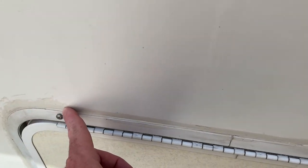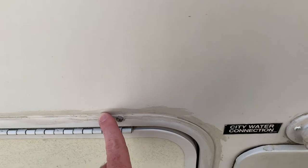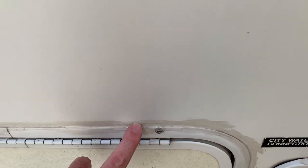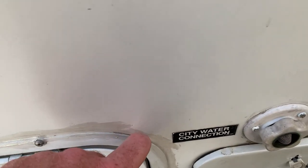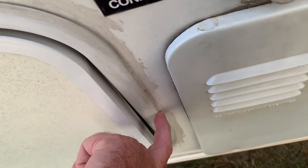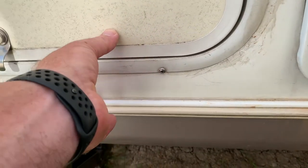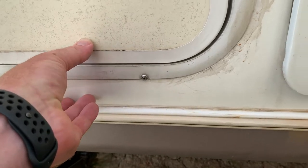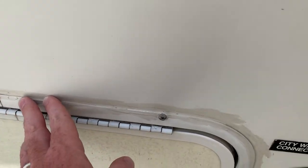You can see here that I've got this kind of messy caulk job, but it is sealed this way. If you don't seal this and you've got a little gap in here, and I see a lot of campers that have a gap in here, mine did too when I bought it, water's going to run down the side, down the inside here, and it's going to get into your wall and do damage to your wall. And it will definitely collect down here below your locker door and do damage because you'll have a lot of water in there. So make sure that you've caulked this seam here